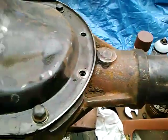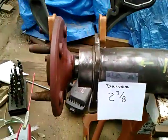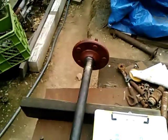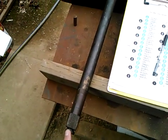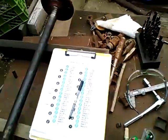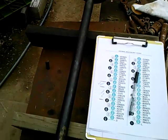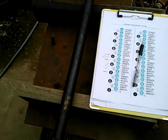And the axle shafts themselves, I found, were not exactly 3 inches different between the long side and the short side. I had both axles here, the long and short axle. Of course, the long axle is here at the moment, but laying these two side by side, the difference in length by my measurement was 2.960, not a full 3 inches.